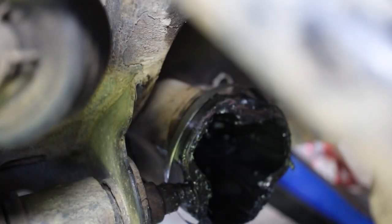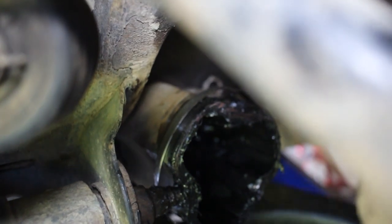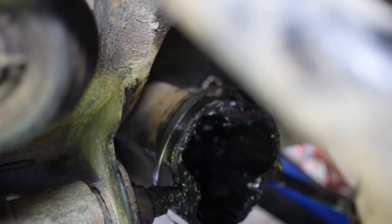Okay, and so now, moving this skid plate and then making sure that I have an oil or a catch can, making sure that we have a catch can beneath so that any differential fluid that leaks out will be caught in the catch can and not end up on your garage floor. So with that skid plate removed, you can more easily pry at the differential.